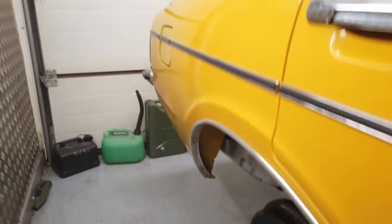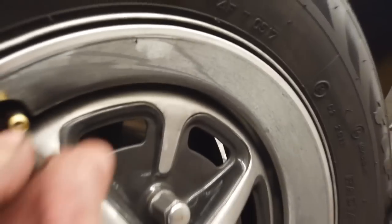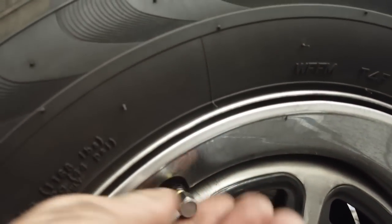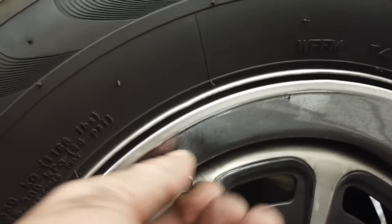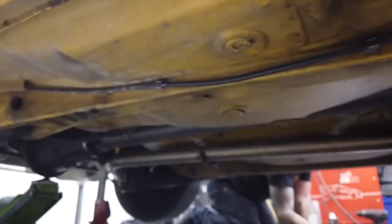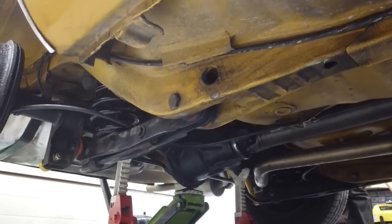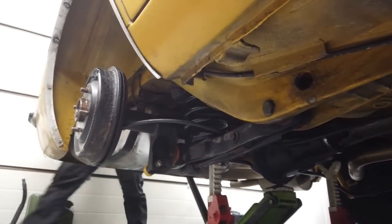We've bled the back. Let's just see. By the way, the axle feels stiff. Me and Richard are dubious about this axle. It's from a dubious supplier as well, but it does show signs that it's been built, all new bearings in the axle. It just felt very stiff to rotate. Now, we have put fluid in it and hand turned it first, sort of to prime it up, if you will. But the axle is newly rebuilt, but felt really stiff. Notchy.